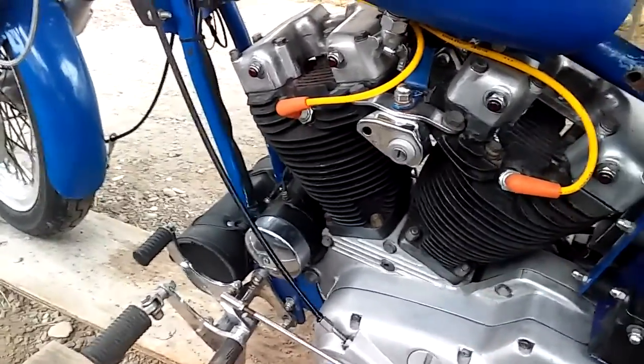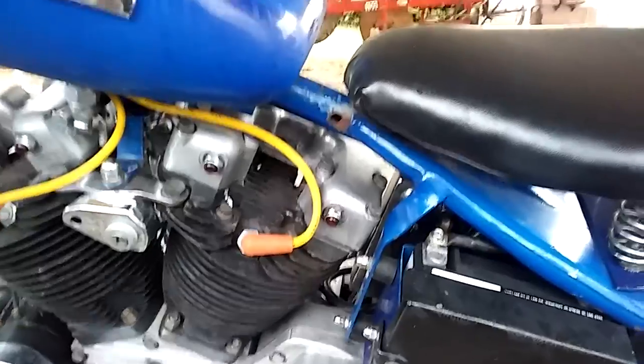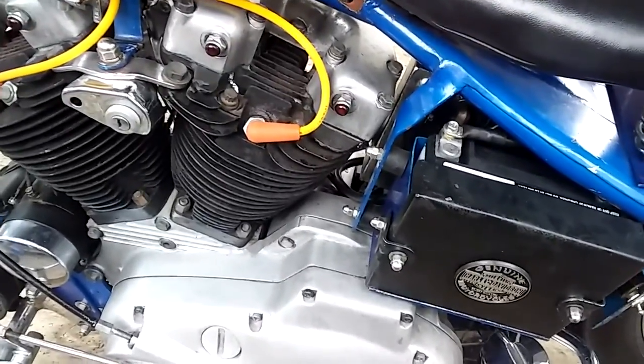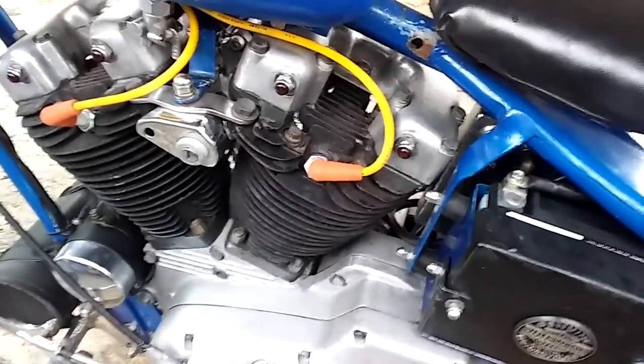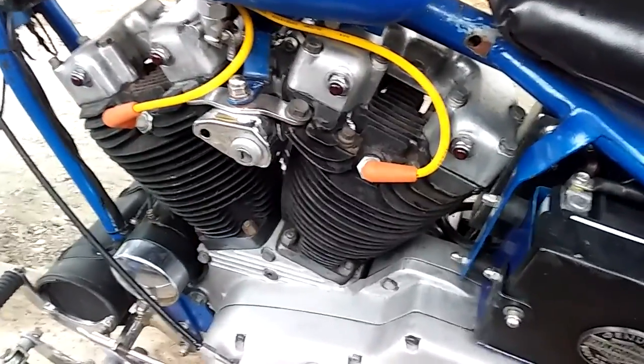But yeah, let's say your battery's draining just a little bit, just enough to where it's not allowing your bike to charge, which is usually about 10 volts. 10 volts is where the starters, for some reason, don't seem to even try to kick the motor over. On a Harley Davidson, it could be less than that too. It just depends on the bike. I've noticed how much electricity draw and things like that.